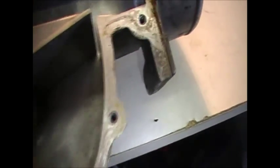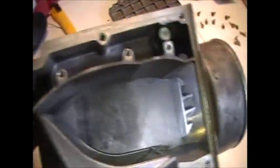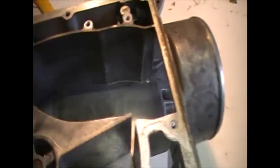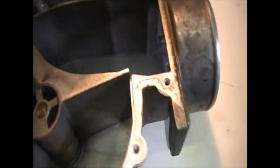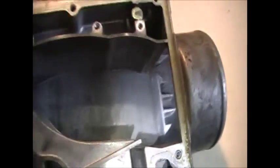I've cleaned it up the best I can — it still looks a bit grotty in there but it's not that bad. I took to it with distilled water, some toothpaste, and a toothbrush to clean these rough areas up, making sure I kept clear from the sensor area — didn't want to get any water near that sensor. I used distilled water because normal water has chlorine and things in it that can cause corrosion. The best I'm going to clean it is with a toothbrush and toothpaste and distilled water. I then cleaned up the back area and blasted it with the mass airflow sensor cleaner to rinse it off, then gave it another rinse to get rid of any remaining residue.